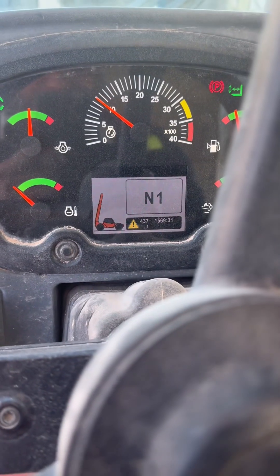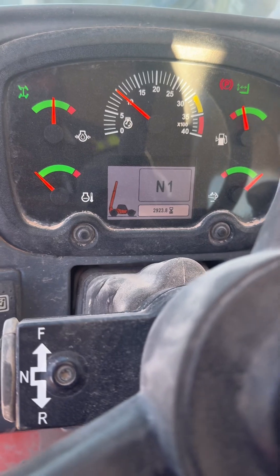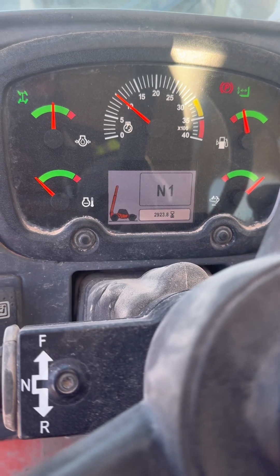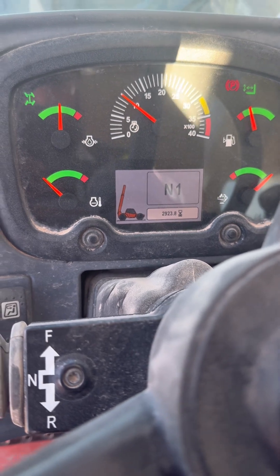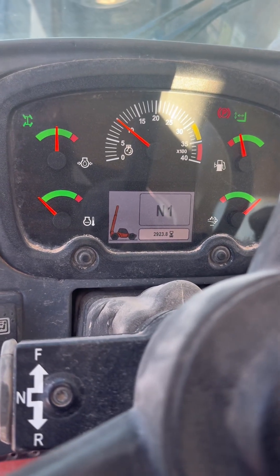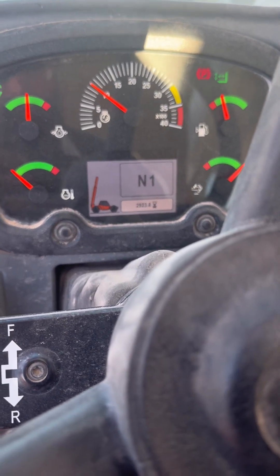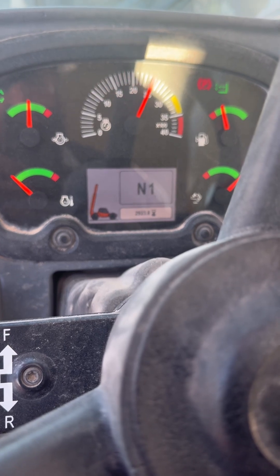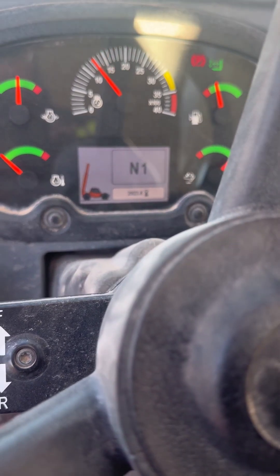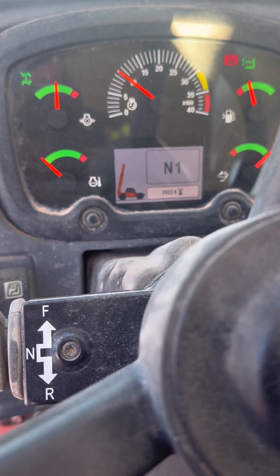There it goes — all the lights went off. The code went away. Give it up for Mac, dude — that was a really cool thing. I wish I'd have known that sooner. I only towed it out here because I didn't have phone service for the laptop. Keep in mind you can use the Mac scanner on JLGs with the Cummins engine. I hope this was helpful for someone. Don't forget to like, comment, and subscribe. Thanks for watching. Bye.